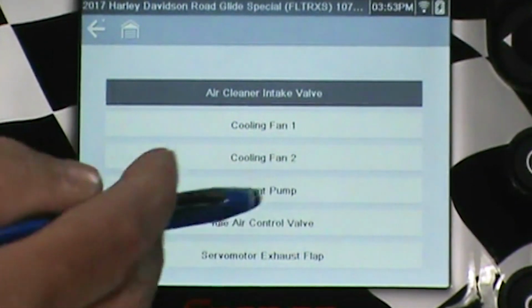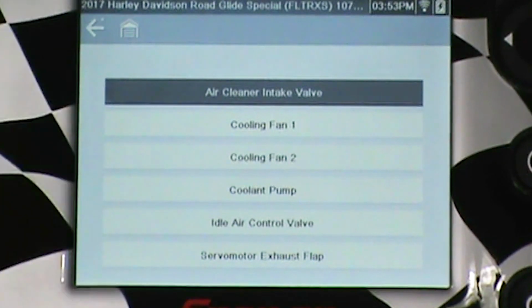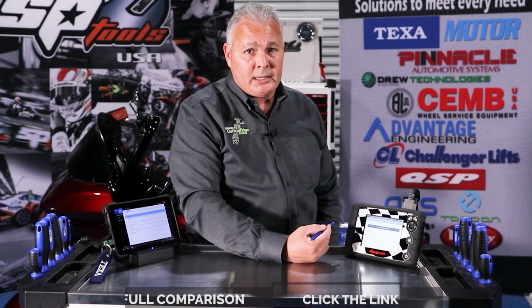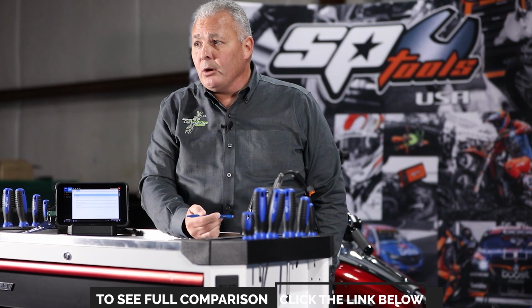So essentially, we have 6 tests displayed or optional, 3 of which aren't applicable to the vehicle. The other 3 we tried. They're all key-on engine idling tests. We didn't have any success running those tests either. It is possible that we didn't do the test properly. There are no instructions in here on how to properly run that test. I'm not, by my own admission, a Harley factory technician, so I'm not sure exactly how those tests should run.